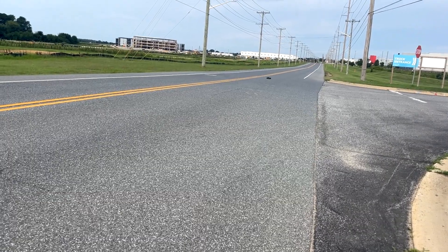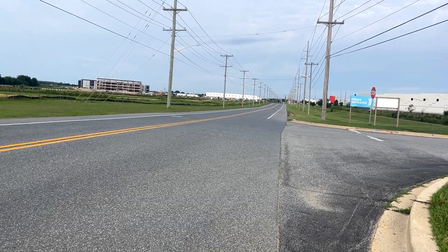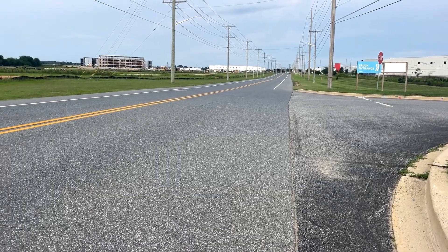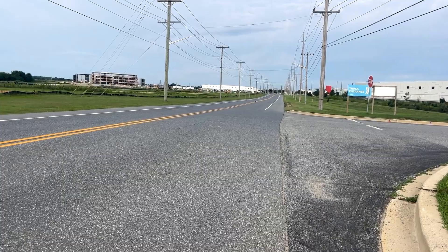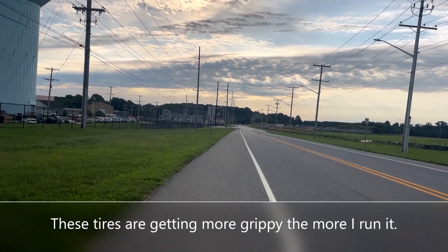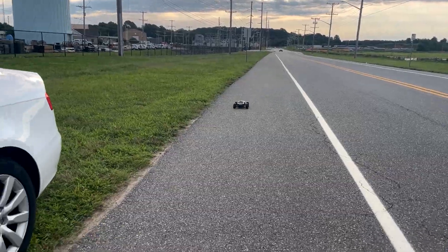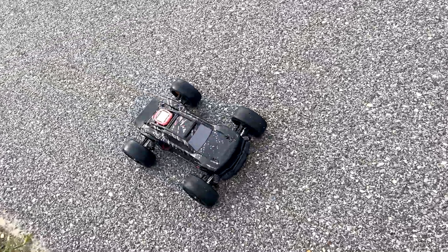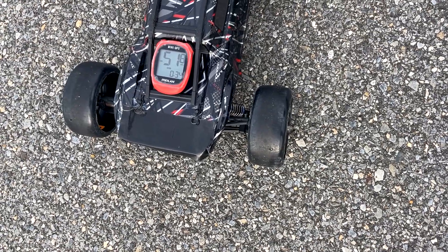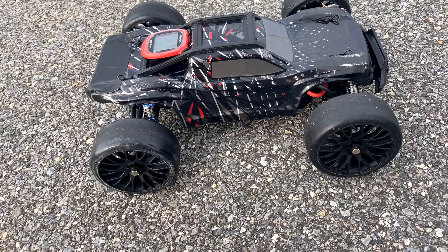These GRP tires won't balloon — they should be more stable than those larger Amrock tires that were ballooning really badly. However, they're really slick, especially on a cool morning like this. It's only in the low 70s, so it's kind of like driving on ice. I'm easing into the throttle... full throttle. Someone left some trash on the road I just ran into. The truck was real twitchy — I do need to try to get some of the slop out of the suspension. 51.8 miles an hour. My previous run with the GRP tires and a 16-tooth pinion gear was only 46 miles an hour, so we picked up nearly six miles an hour.